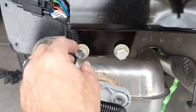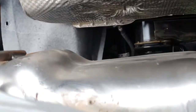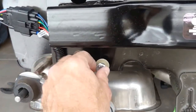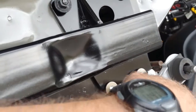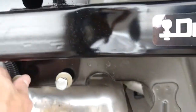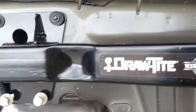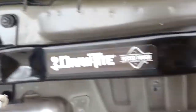As a side note, before you tighten everything down and tighten the bolts underneath the mufflers, it's good to temporarily fish these bolts through to make sure your bumper is lined up. Some people have a problem getting these bolts through after they tighten the bottom and upper bolts. So it's better to get these on first, make sure your bumper is perfectly centered — mine's good, I've got free play on all the bolts. Now I'll tighten the bottoms, tighten the other bolts, and throw the bumper back on.